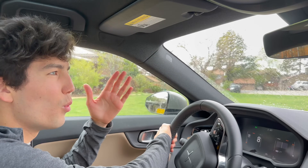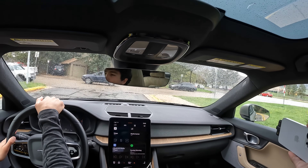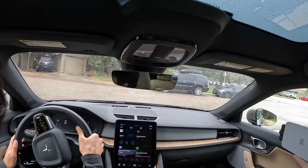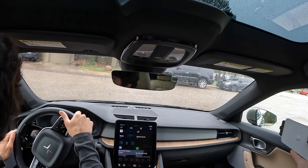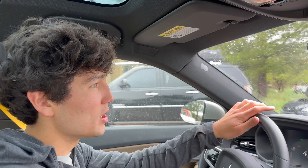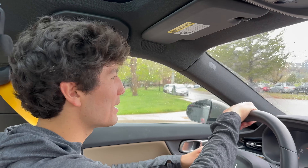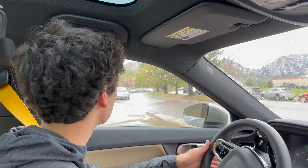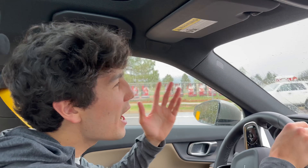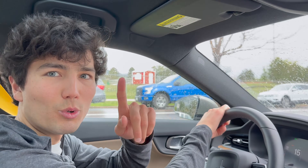As a quick primer — what is regenerative braking? It's really cool as a technology. It's what allows you to basically roll motors backwards and create an opposite effect. Normally we put electricity into motors, it makes them spin — the rotor part of the motor, the part that moves — and you move forward. With regenerative braking, you take the kinetic energy from rolling backward and an electromagnetic field basically puts charge back in the battery. It's really cool technology, but there are some more nerdy details and a lot of surprising differences between every automaker you need to know about.